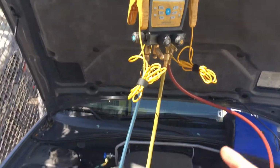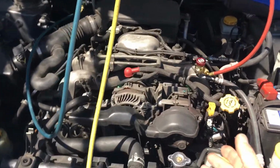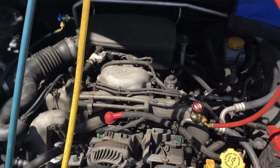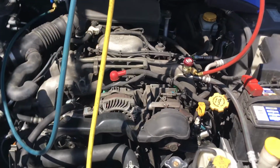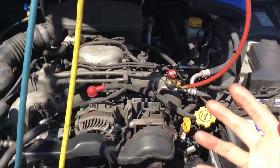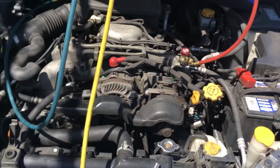That's it. Just showing you that you don't need to waste refrigerant to the air, because if you have dry nitrogen, big leaks like this you can find really fast without even bringing over the machine, or wasting refrigerant, or contaminating our air with more refrigerant that we don't need in the air.